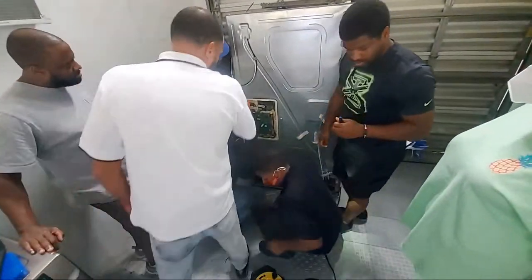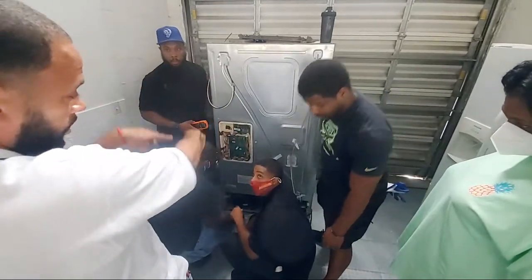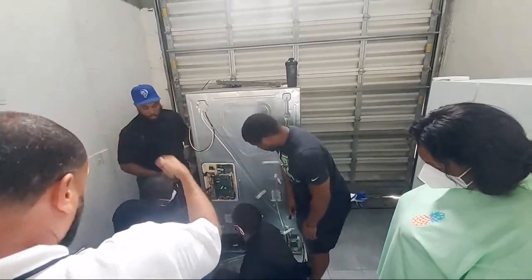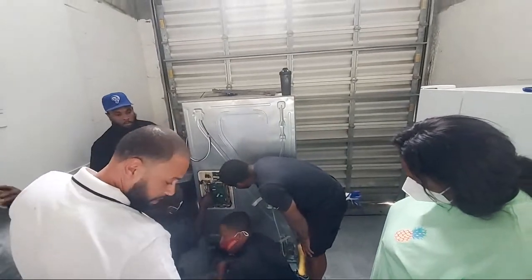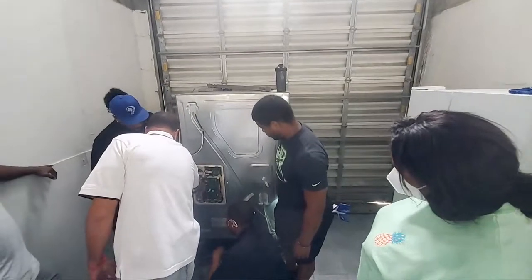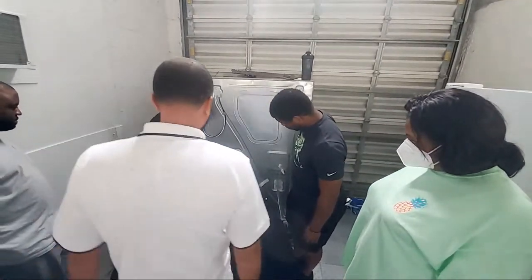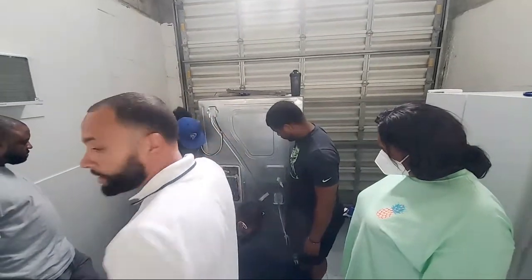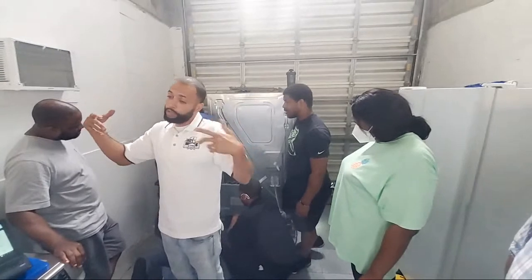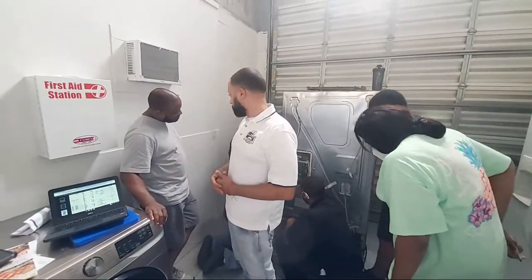Alright, unplug it then. Unplug both of them, and keep that mental note of where you got your leads. Is the unit plugged in? They turned it off. Unplug it. Where you had it at, go like this, and do that measurement. Those wires go all the way up into the heater element, so we're testing the heater element from the board, you with me?